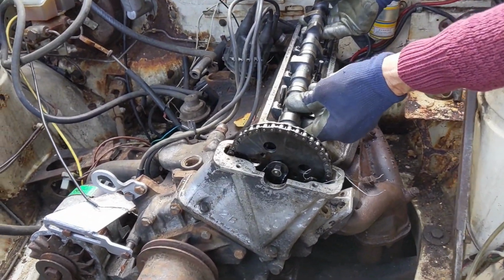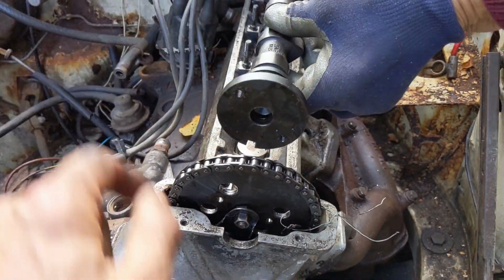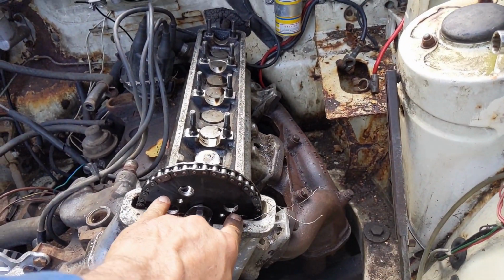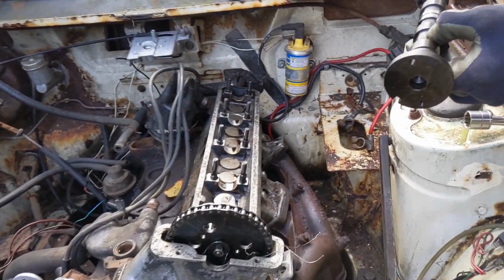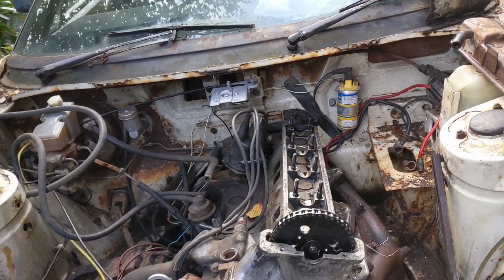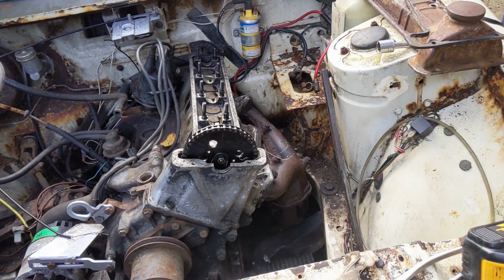So we've got both of the bolts out. We can take this out. We're noting that the stand part is at the top, so we know that this will all turn together. So now we know how those 2 line up here, for the end of the cam, and the notch is at. Okay. So we know how that will go back in now, and we've got that off. We're just going to make sure we pull out this tab as well. And good.